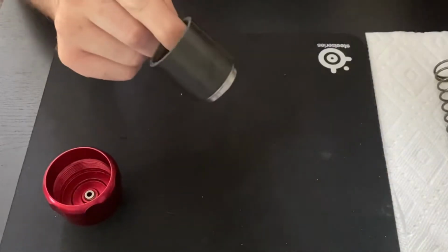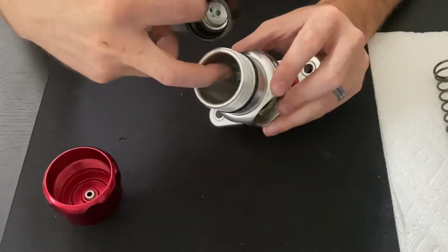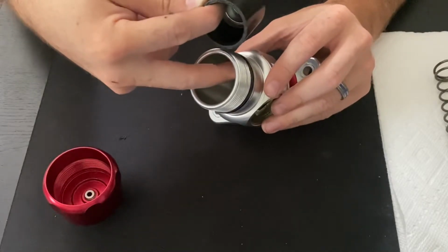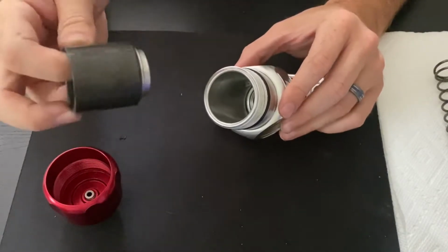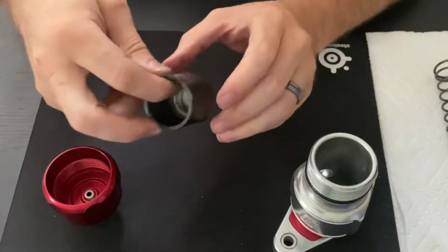Make sure it's always kept clean, because inside this bore, if you get dirt in here, debris, stones, sand, honestly anything, it'll start to scratch. This is pretty soft aluminum. It can scratch pretty easy. This is a brass, sometimes steel piston. So we'll go ahead and set the blow-off valve body over here.